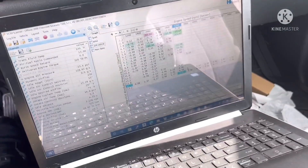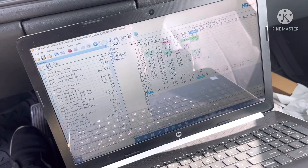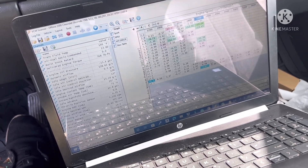With that pull, it suddenly felt like the rear end was about to blow up because it was making more power and had more tire spin. It's a G80 - they call them Grenade 80s for a reason. I could hear the tires kicking back and forth, both of them fighting to lock into the posi, but it didn't sound very happy. They didn't do that before - I guess they didn't have the power to spin that hard before. Pulling over to a safe place to take a look at the readings. By leaning it out - going from around 12.0 to a 13.0 on the AFR - let's see what kind of improvement we made.